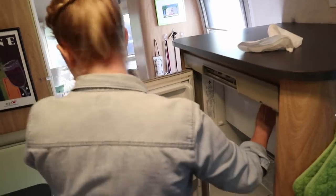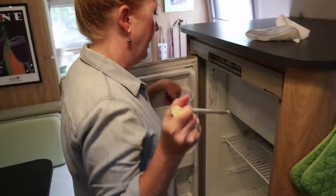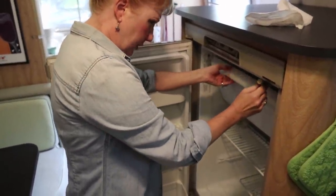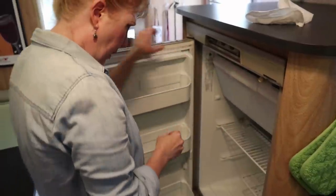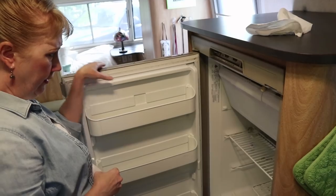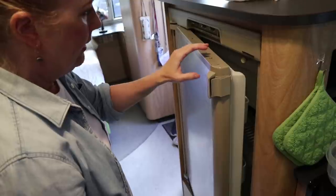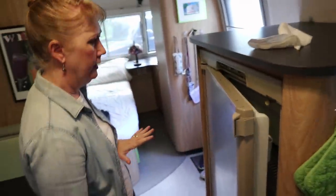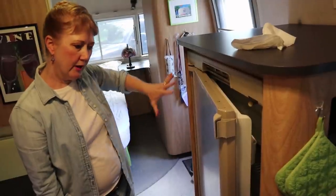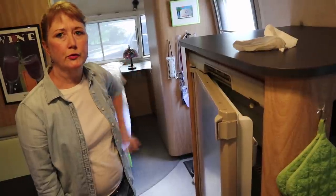As far as storing it, this is where the curtain rod comes in handy again - multi-function! I'll stick it right in the freezer compartment so the freezer compartment stays open, and so you can't form mildew there. That will help keep the door open. It keeps all the air circulating and will reduce the possibility of mildew and bad odors.